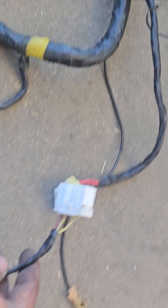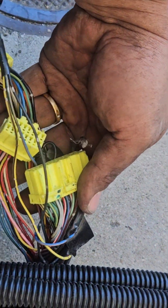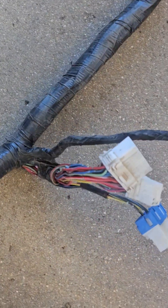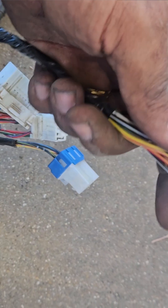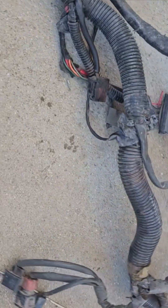Just a quick overview while it's all fresh in my mind: this connector goes to the center console, this is the main relay harness, these three are obviously the ECU harness, this ground went on the center console, and these are the four mystery plugs — three behind the dash and one by the AC vent. The rest of this is all engine harness stuff that we're not really using.